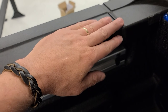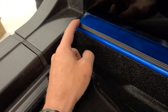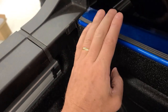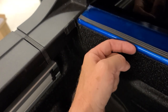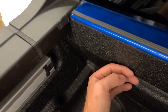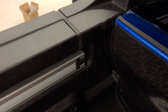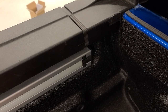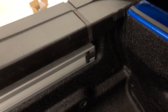I just wanted to point that out. Number one: seal off this spot right here. Number two: make sure you have a good bulkhead seal that actually fastens to your bulkhead itself. If you've got something like the Gator SFX that just sits on top of the bulkhead, water can wick underneath and run down to the front side. I like to try to channel everything to the corners to get it out that way. Hope you found that helpful — let me know if you have any questions. Seals like this you can get at your local hardware store.